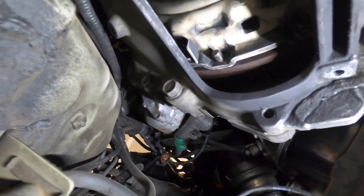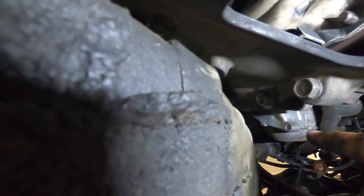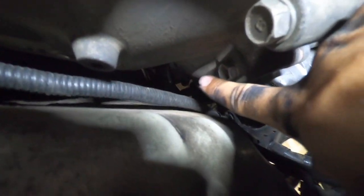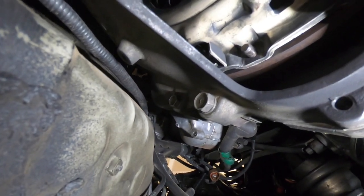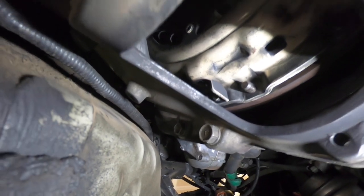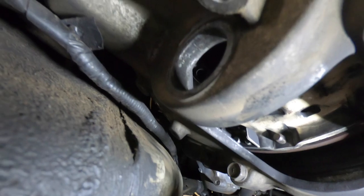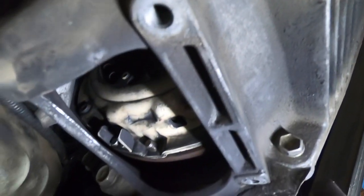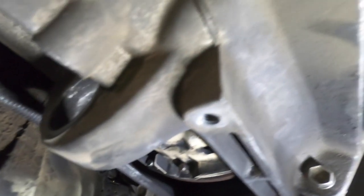Now I'm going to start taking out the bolts. The really hard ones are the starter bolts — there's one here and one all the way in there. The others are pretty easy and aren't torqued terribly high, I think around 50-something pounds. The hard ones are the starter bolts and the two up top, because you've got to tilt the transmission quite a bit. I'm going to try to get a good angle and make a proper time-lapse of that part.